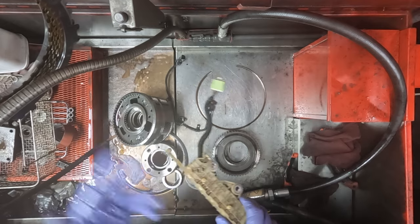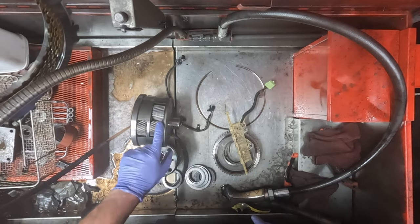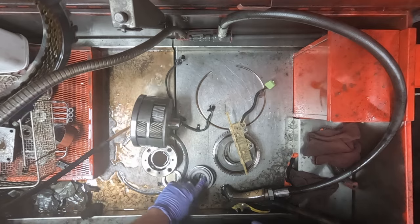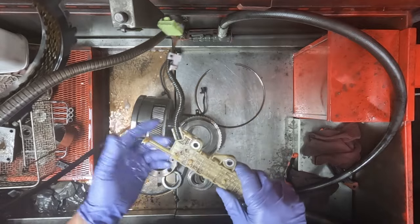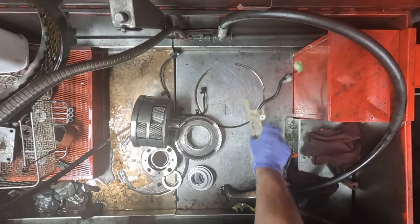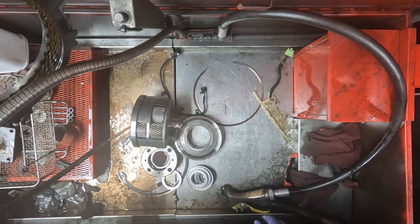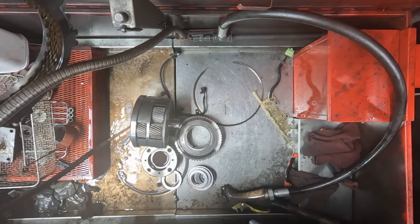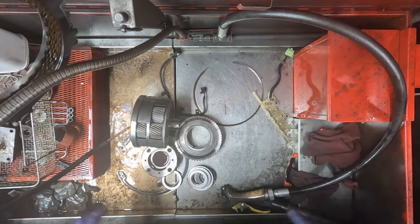It'll do a good job of cleaning the outside of this stuff, but it also tends to leave a soap residue, and we don't want that soap residue to get in and dry out and stay on these components inside the bearings, inside the planetary gears, inside the sprag assembly, or to get moisture or water inside here, and we might not be able to get it cleaned back out, and then that leaves potential for some type of failure or problem in the future that might spin you in circles, wasting time. So best to do these things by hand right here and in the solvent that will not create a problem with moisture.